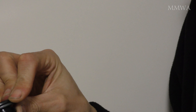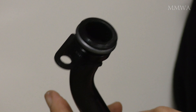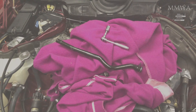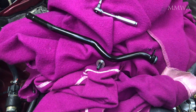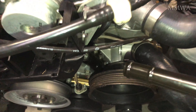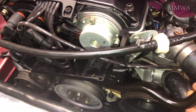That's the end that actually slots into the water pump — easy job, you think? Indeed it should be, but let's remember this is a pattern part. Firstly, I got ahead of myself and I just had to unbolt the top shock absorber mount for the tensioner, and then this pipe can happily slide in behind the plastic in that area. Before pushing it into the pump, I will lubricate that O-ring with silicone grease.